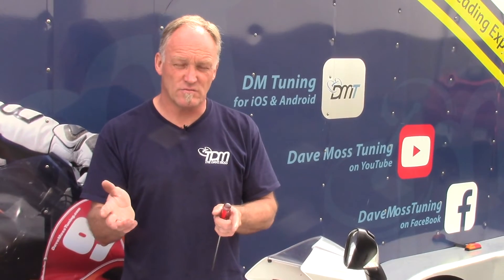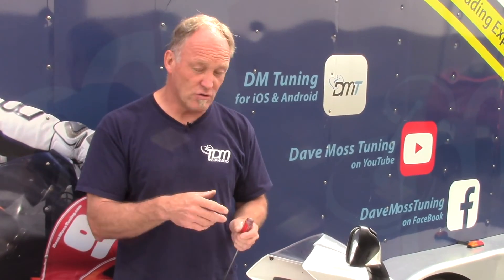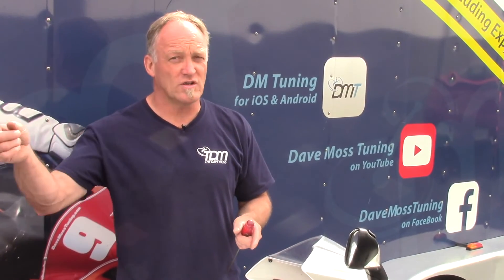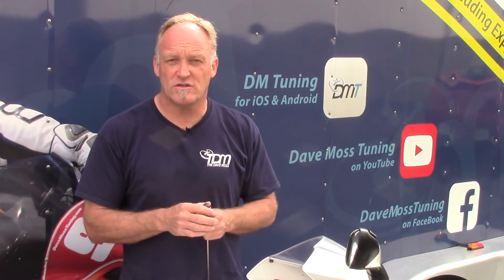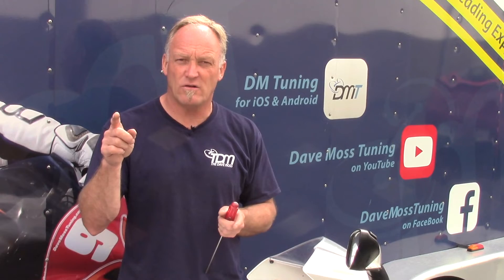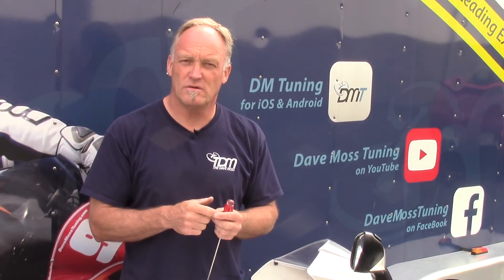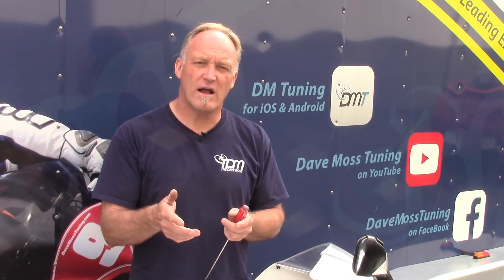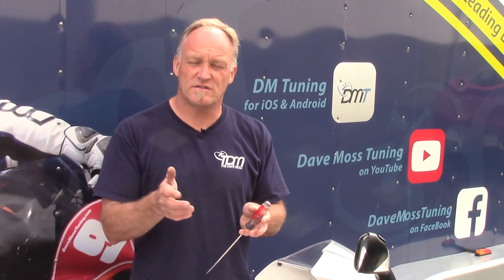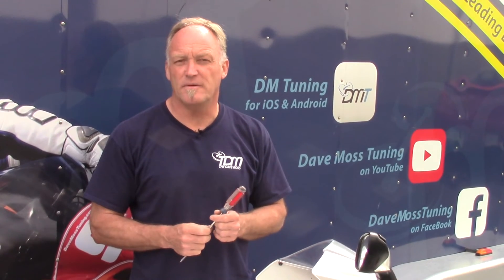Investigation will tell you and yield where it works and where it doesn't. That's what we do in the suspension school — show you how an adjuster works and how it works on track. Theory, practice. You can experiment with the compression adjuster yourself by having it all the way out, 25%, 50%, 75%, and all the way in, and see how it feels to you. It doesn't matter whether you're on the street, track, or race — figure out where it feels best. All you need is this or an allen key to get it done.